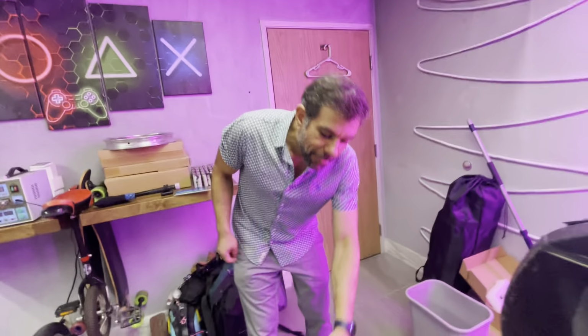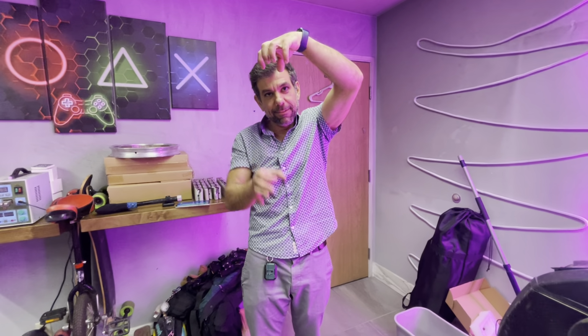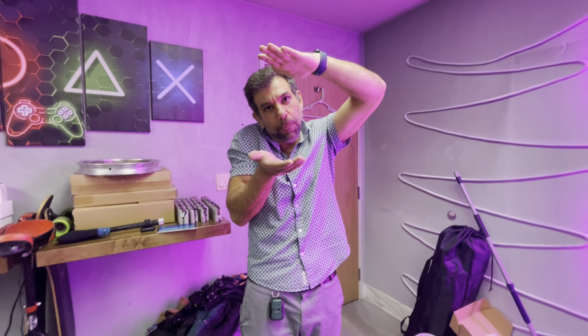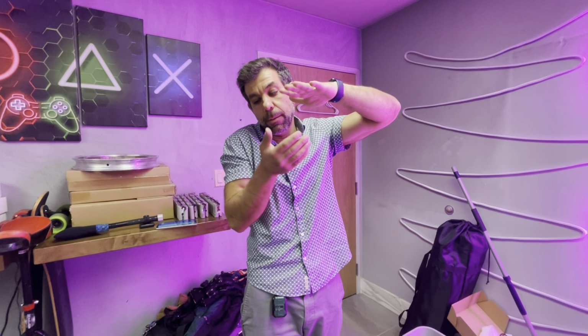Okay. Yes. Those things are the crown of the actual spring that is inside of that cylinder. So as you turn those, you compress the spring. So that's directly related to how heavy you are. The heavier you are, the more you want to compress that spring. At a certain point, you can't compress it anymore. That's when you go up to the next step in suspension stiffness, or weight, what they call it. I recommend almost everybody buy the heavier one, unless you're less than 120 pounds. And I guess now there's even a third, even heavier option, which would be good for somebody like Ash.